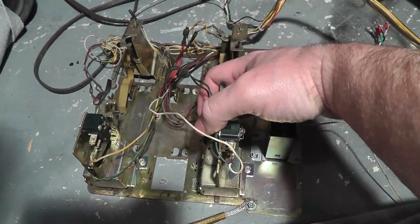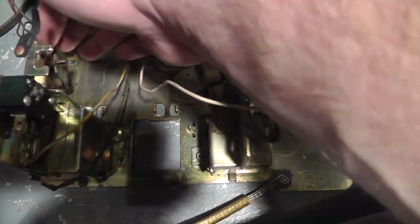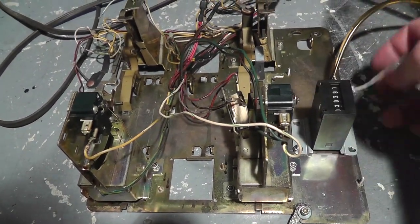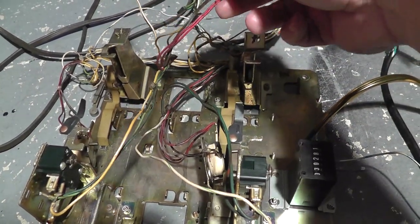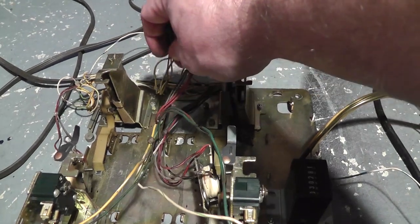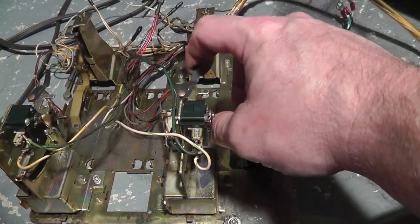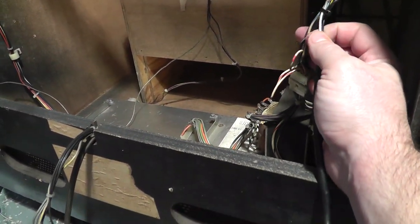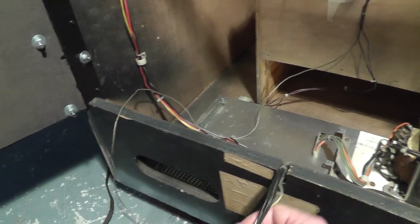One of the lockout coils seems to be disconnected from the coil, which isn't good. There's also extra wiring for a third coin slot. That's basically the minutia of having to rewire all this — I'm going to undo the hack, splice it back in properly, and get a Williams power supply. Some people would say why bother, but I think I'm going to do it right.